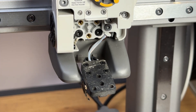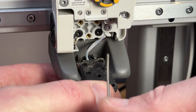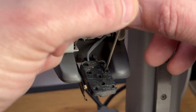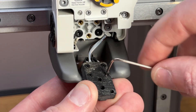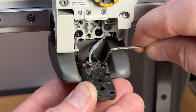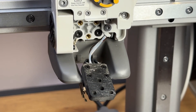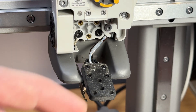These are the ones that come loose, and when they're loose your nozzle can't calibrate correctly. I've already checked this and it's fine — I'm just going to show you. They're normally just like this, partly tight, not fully tight. Get your allen key and just make sure each of these is snug. Don't over-tighten it because it's going into aluminium. I've actually put threadlock on these just to make sure they don't come loose again, because the heating and contracting with printing seems to loosen them up. I suggest using a tiny dab of threadlock on each of them.